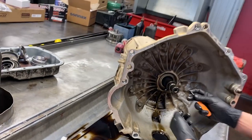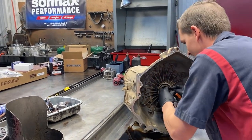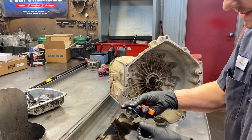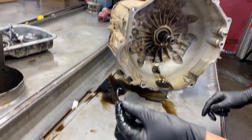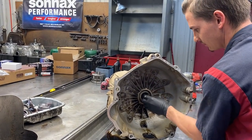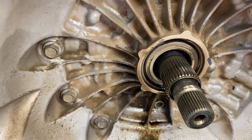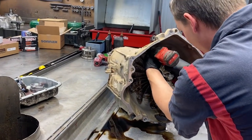It's pretty smelly. We're going to go ahead and get our TCC O-ring off - and it just broke off right there. This is your lockup O-ring, squared - not even around anymore. I should have felt that - I bet it felt almost flush right there. I like to take all of our pump bolts out but one - leave that last one in there.